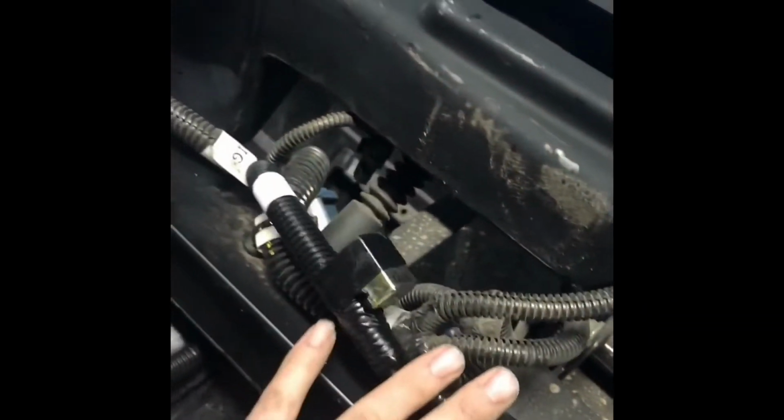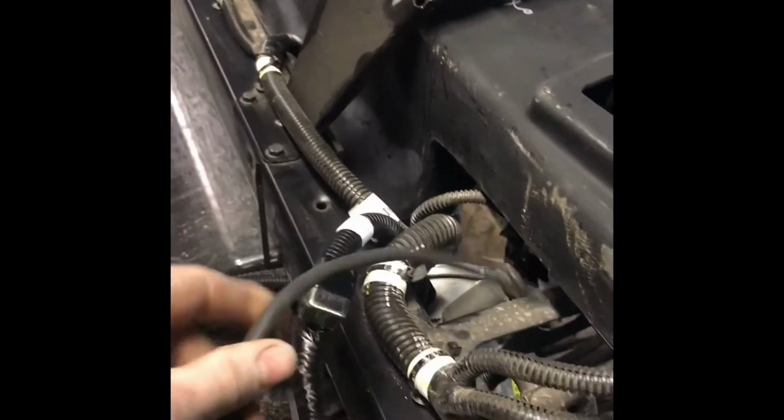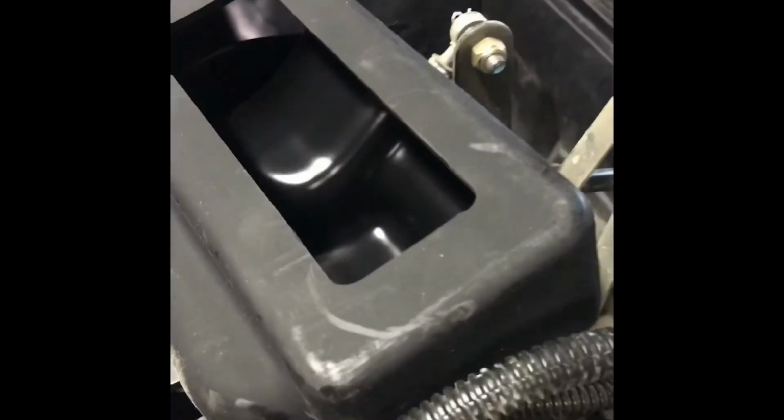This one we're going to do a wiper. So we got the wiring for the wiper. That's going to go down this side. And it's going to go, got it, ran right here, it's coming across. It's going to go through and then out right here. A little better take on it. And then run it across. Yeah, don't forget to run your washer hose. Because if you forget to do that, you're going to be really mad at yourself.